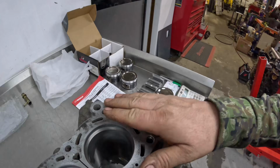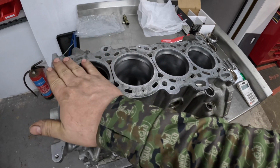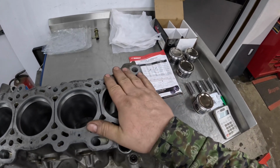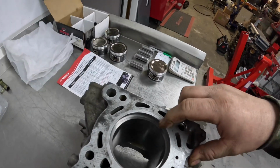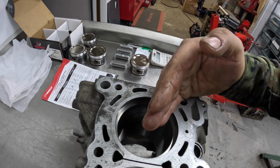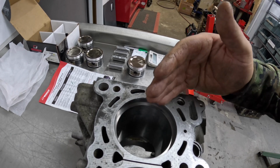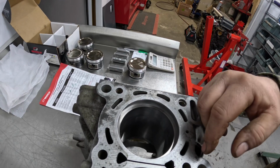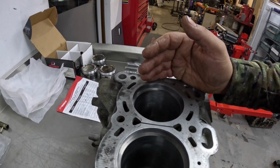So, and the other thing is, we've just measured this cylinder number 4 at 12 thou, but I'm not just going to assume that they're all set at 12 thou. We're going to measure cylinder by cylinder, and also because we want to get this to 23 thou, I'm not just going to take 11 thou out of this ring gap straight away, because what I don't want to do is set it up parallel, but as the ring gap alters, it might alter the parallel position to the bore. So I'm going to take 6 thou off it first, then come in and measure it and just make sure it all still looks at 90, the gap looks at 90 from the bore, and yeah, do it in bits and just make a better job of it.